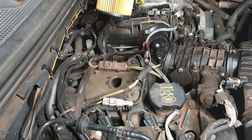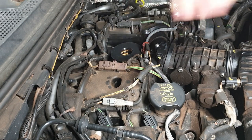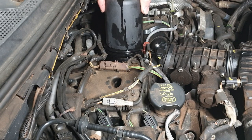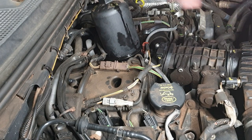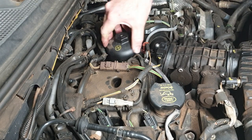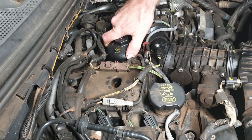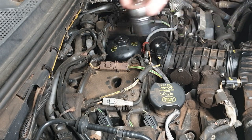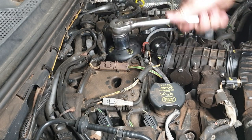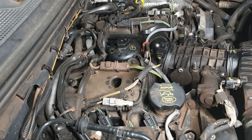So as I mentioned, that spigot for the oil filter goes down first. I just rotate it around and then you'll feel it lock in, and just push it down in place, it's as easy as that. And the filter cartridge cover can just screw on. This doesn't need to be super tight — I think the spec is 32 Newton metres, so I'll just do it to that. Once it seats down, just give it a nip, and that's it.